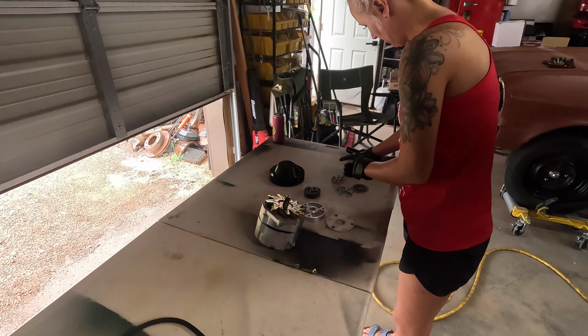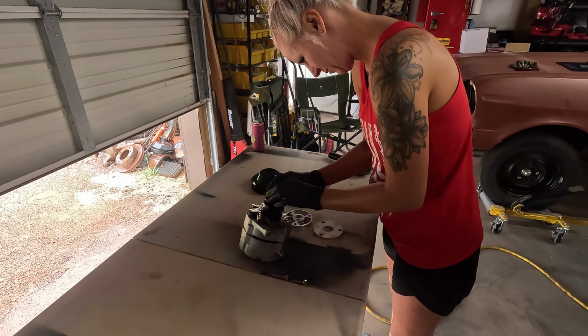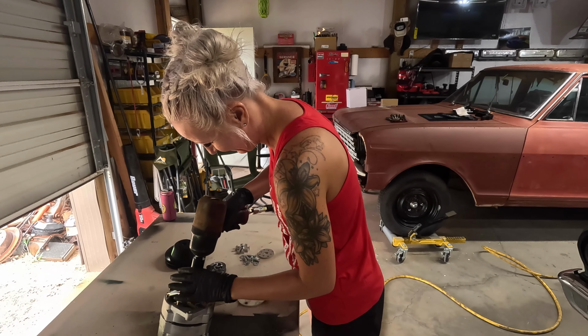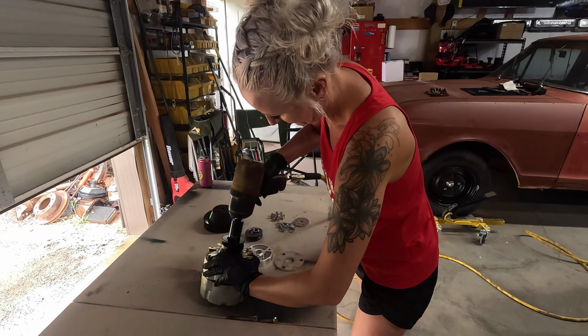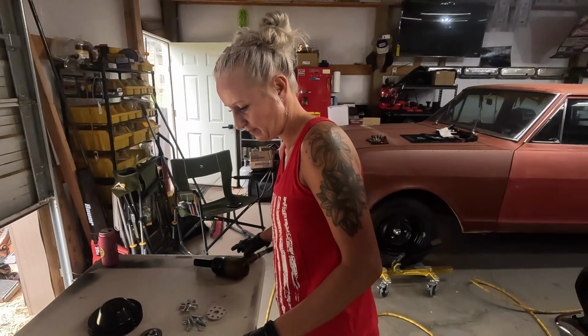So, all right, new pulley on. Make sure it can go on correctly. Then switch it. Yep. Go the right way. Give it a couple ugga-duggas. Okay, real ugga-duggas. Fine. All right. So there you go. That's the easy way to change your alternator pulley. An impact and some ugga-duggas.